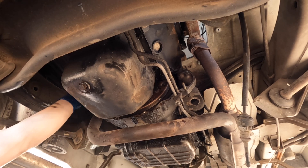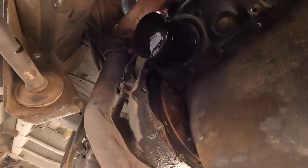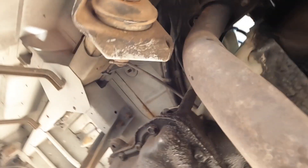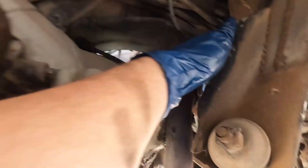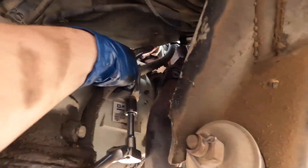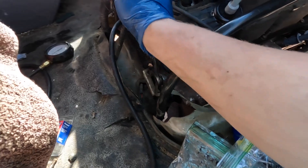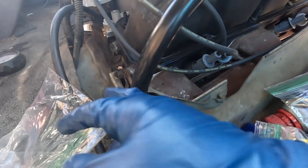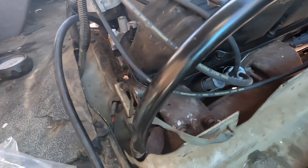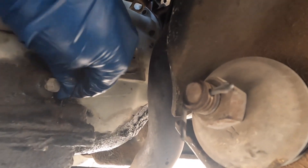Let's see how much oil I can spill — oh, my hands are oily. Now we've got all the bell housing bolts out. The last thing is the bolt holding the dipstick up here. The dipstick hooks into the head up here — looks like it's a 9/16ths bolt. The battery died so I'm not sure how much was caught on camera, but that bolt was holding the dipstick. I had to bend the tab out a little bit and push the dipstick up — now we should be able to get back under and wrestle the transmission out.